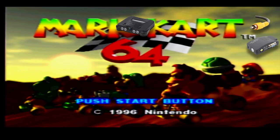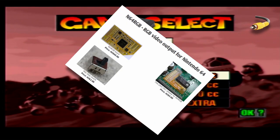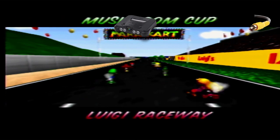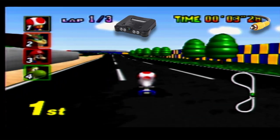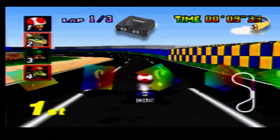The N64 has no native RGB — you need a special chip to do this and it's really expensive. I'll be looking into making my own converter from the NAS chip inside to RGB. They do exist but they're so expensive — over a hundred euros — it's not really an option. This looks decent on a big screen actually, just a little dark; you could adjust the brightness. But if you're using composite nowadays it looks blurry and not good at all.